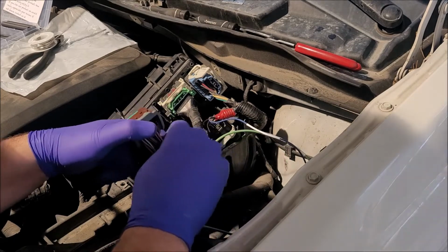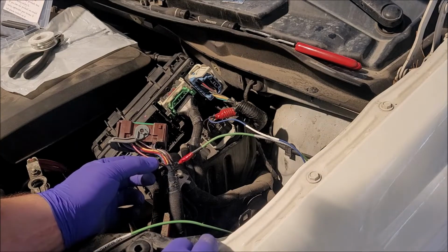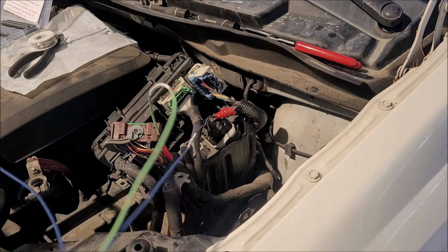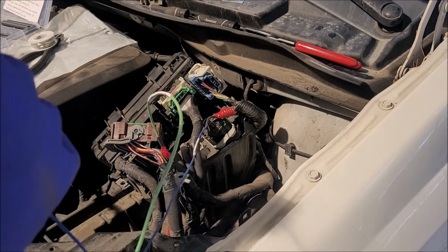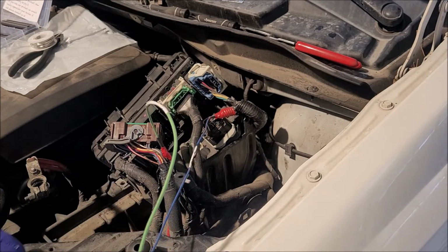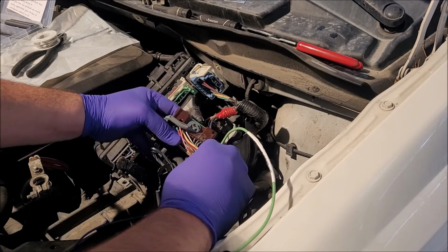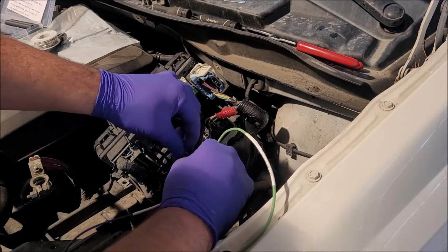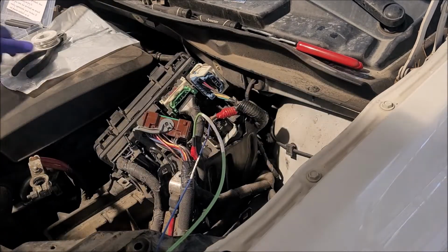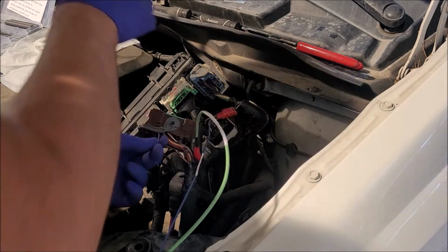Now this is gonna be our trigger wire. And what they want us to do is just slice it back a little bit. And then we got our pink with our green trace goes to 86 to trigger our relay on. So what I'm gonna do is we're just gonna cut it. We're gonna strip both sides. We're gonna put our heat shrink on, and then we're gonna put it all together as one. Make sense? Makes sense.